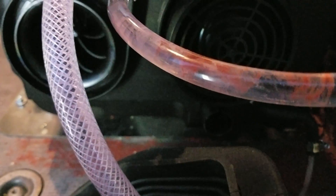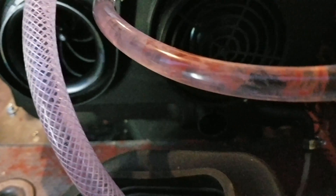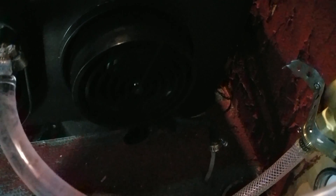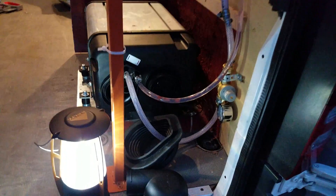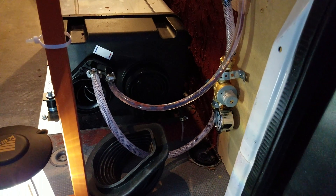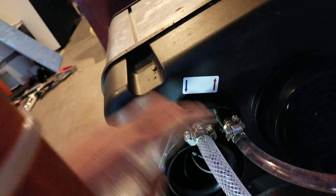The opening down here is the air that actually gets burnt for combustion. I'm probably going to run that line internally for now since my exhaust comes straight underneath the vehicle — I don't want to be sucking in exhaust for combustion air. And right here is the diesel line. This unit ties into your vehicle's diesel tank; it has a little pump that pumps from the diesel tank, which means you don't have to have additional fuel tanks or worry about fumes.